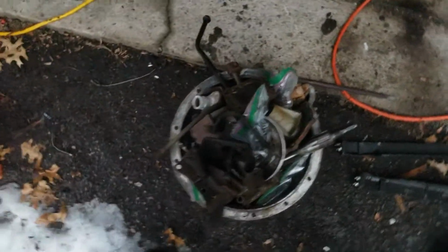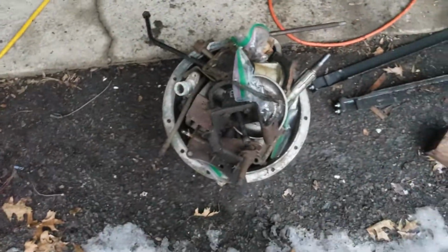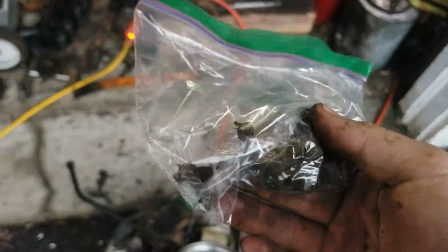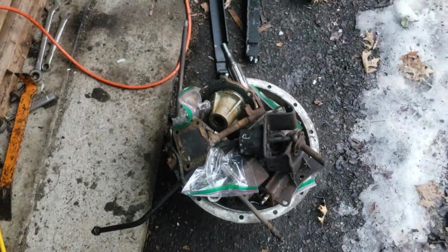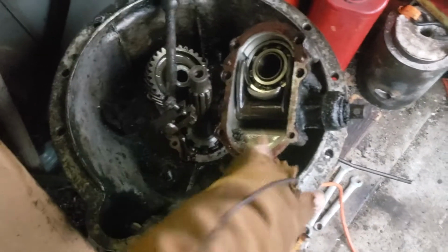Whole pile of parts, 2A bell housing, and all the parts I stripped out of it. A few other miscellaneous parts in there. Ooh, I should pull my tray out. I don't remember what these bolts are for. A whole bunch of little tiny ones, and they've got the thread that Rover used to go into aluminum. So maybe they hold down part of the cover, or part of the throwout mechanism, but I thought those were all studs. That's what it looks like on this one anyways, on my original Suffix A.